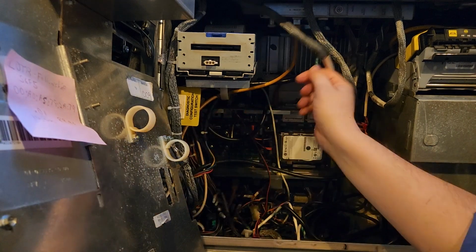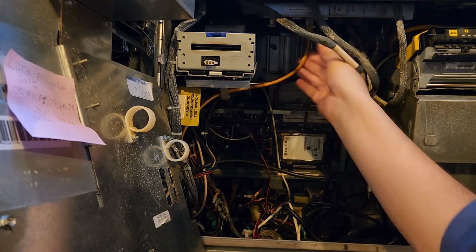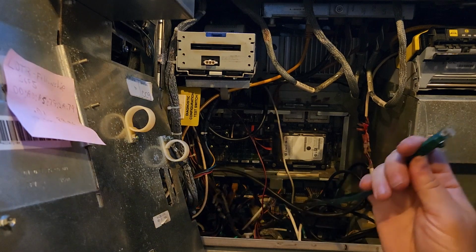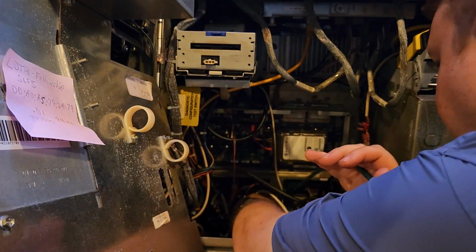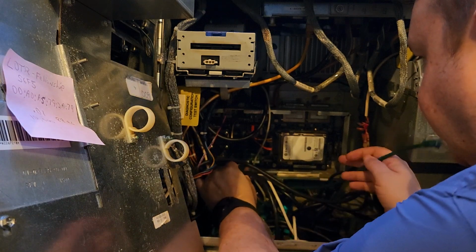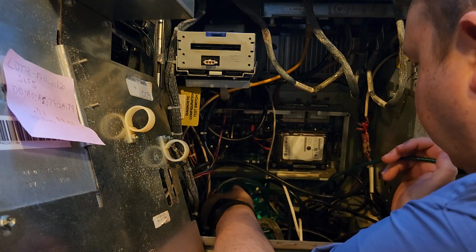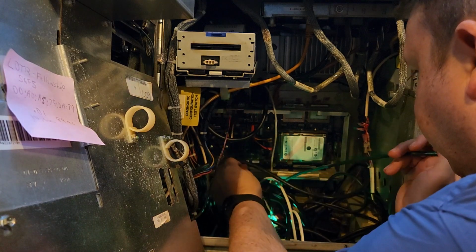That one looks good there. Let me just move it over one just in case it's a bad plug. It shouldn't be though. And then trace this one to make sure this one's good. If you have a mechanical reels timeout and the reels are actually jiggling like that, then it's a communication error with the backplane. It's not a problem with the reels themselves.